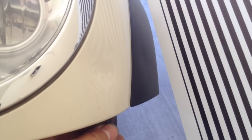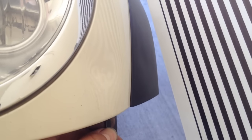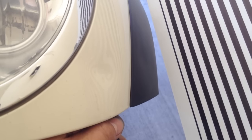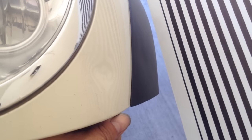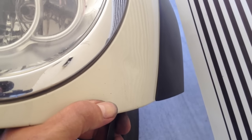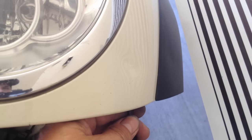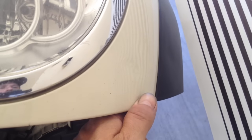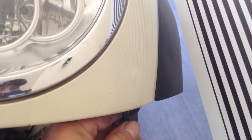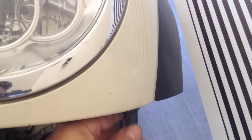As I work my way around the dented area, the lines give me a good indication of my progress. A highly reflective shine is important to see the lines clearly. As I work closer towards the center, I can see that much of the dent has been lifted. The lines now highlight a few deeper portions in the center. At this point, I work each of the remaining dimples as a separate dent.